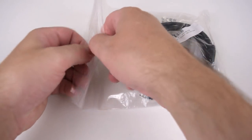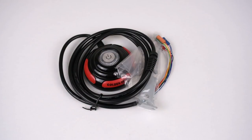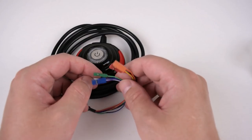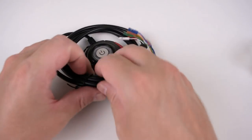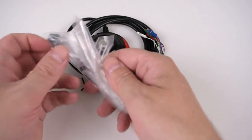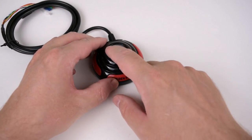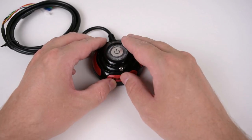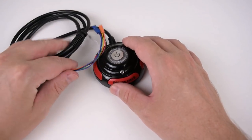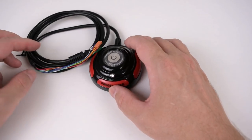And we've got this nifty front panel device. I work with open test benches and what this does is connect to your motherboard's front panel headers — reset, power, power LED, and hard drive LED. The cord is quite long and it even comes with a rear bracket so you can route it out the back of a case. It lights up blue for power and red for hard drive activity, which combines to an orangey color. Just looks a little bit nicer than other front panel buttons I've used in the past, and didn't cost much.